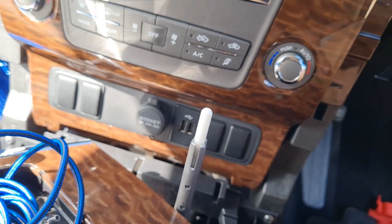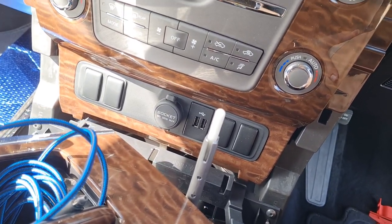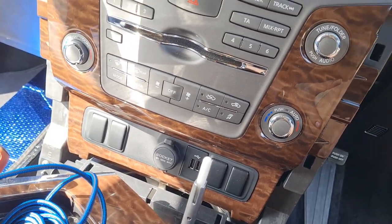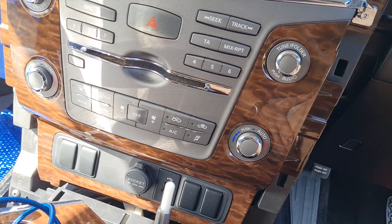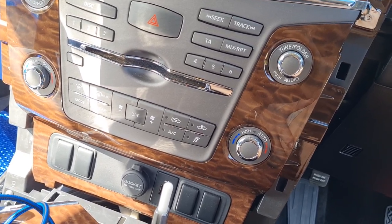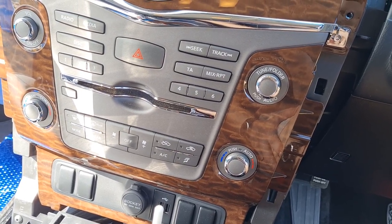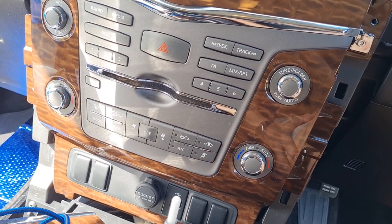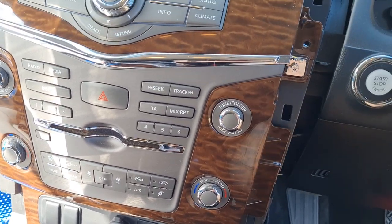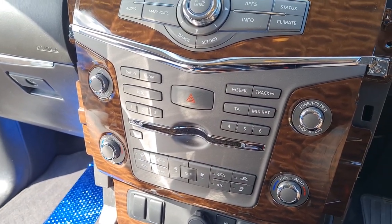Keep in mind the 12 volt panel is sort of attached to it but it also comes away with a couple of clips. Pull that towards you and it'll come out easy enough. Just keep in mind there are only little clips holding it in there so be gentle — and there are a couple of power clips behind that which need to be taken out, so don't be pulling on it too hard otherwise you'll rip them out.